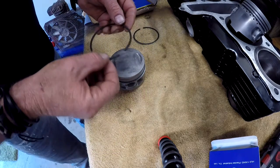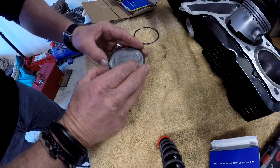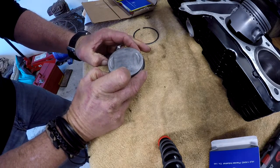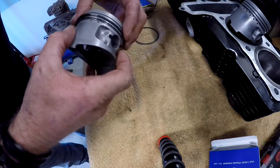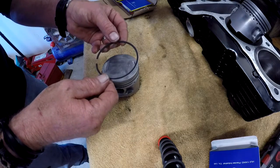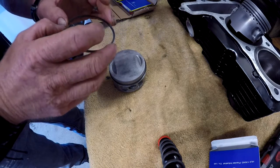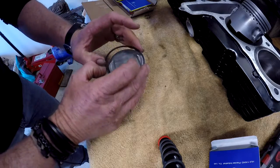This is the second ring and the mark needs to go to the top, very carefully so we don't snap him. Lower him into the groove. The front side is the thrust side, isn't it, because the engine runs backwards. Yeah, but the power stroke's on the down. So it's at the back. The engine runs backwards, it's on the front. It's on the front, correct.